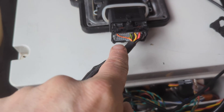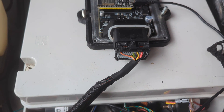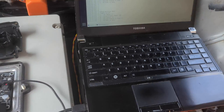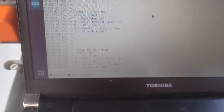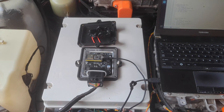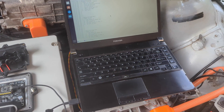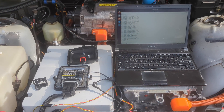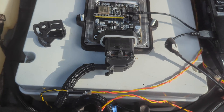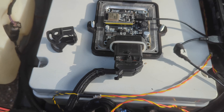After a bit of tinkering with the connections on this connector, I went from having no connection to CAN-H, to having a short between CAN-H and CAN-L, to having working connections. Let's hope when I put it all back together it continues to work — because if you look at the debug on here, it is picking up all 96 cells. So we can reassemble all of this and plug it in and see if it charges, and we do appear to be getting CAN-BUS now. We're charging, but there is still a dodgy connection in here somewhere — it only works when I take the sealing rubber out and shove the connector right in. Not ideal.